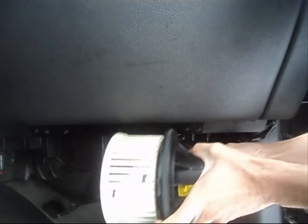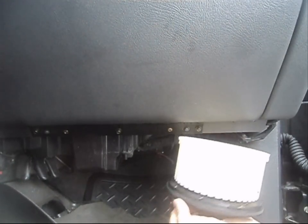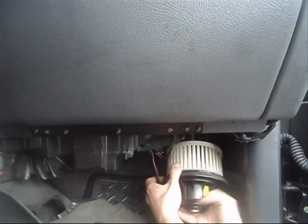It may fit certain applications but it won't fit this one. This is a very simple snap-in. We're going to go ahead and install our unit. Keep this tab here kind of toward the firewall, like this, and install the unit. Grasp the motor housing with your hand and just give it a shake to make sure it is seated properly. Because if this unit isn't seated properly, it will fall out — and if the motor is running at high speed, the cage will melt against the housing. Just grab the motor housing, shake it around a bit, make sure it's nice and tight. Reach underneath and check your tabs — make sure they're locked in properly. Then restow the kick plate, and that's all there is to it.